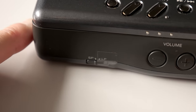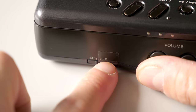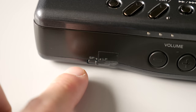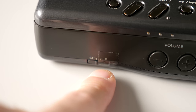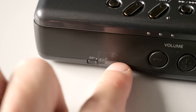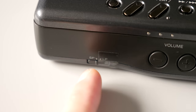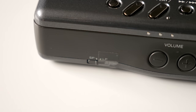The other switch on the front is a little bit interesting — SP versus LP. DAT had a couple of different play modes. SP, standard play, is your full quality 44.1 kHz signal, but you could get extra run time by switching to LP, which dropped it down to 32 kHz. Whoever had this deck previously really wanted people to only use the SP setting, so there's a piece of tape covering the switch so you can't slide it over to LP mode.